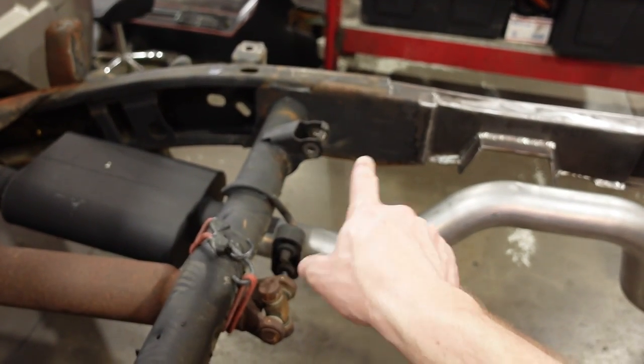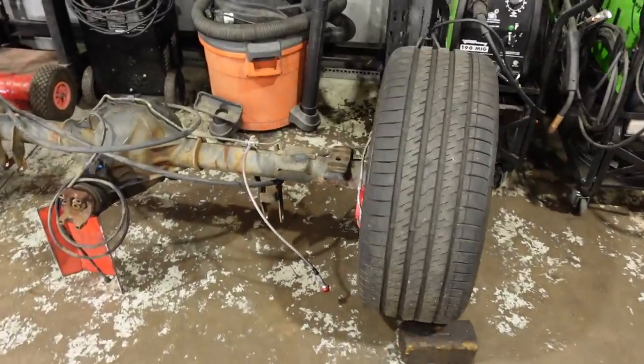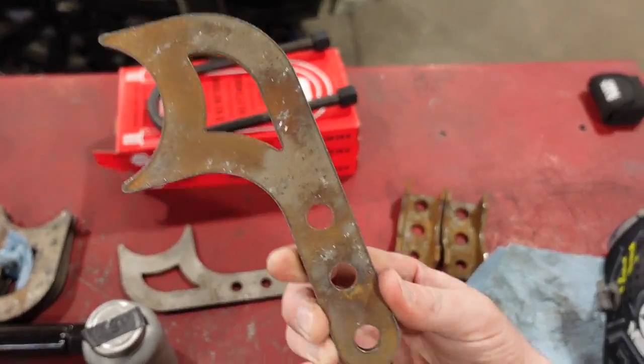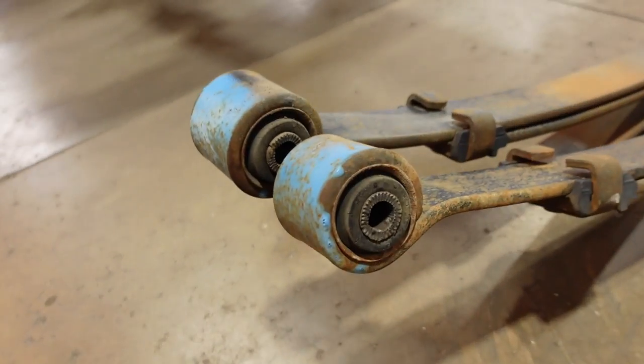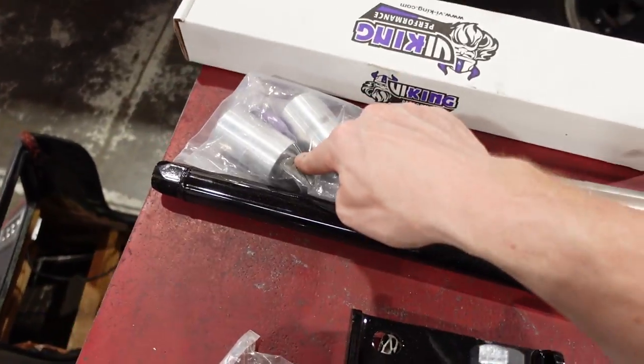We're doing a shock relocation so that mount is going to get chopped off — simply because there's no sense to leave that bracket there. This shock mount is getting chopped off, we're putting some Atomic Fabrication mounts back here, and then on the axle we have to do the same thing — chop off the factory lower shock mounts and weld on the stuff from Atomic Fabrication. Performance links will be down below in the description. Then once we have that done, we'll get a little bit of paint on the frame in the areas we're welding, and then we will install the cal tracks, which basically means we need to press out those two rubber bushings in the front of the leaf springs and replace them with aluminum sleeves. By the end of today's video, everything on that table will be installed on the truck, the wheels will be on it, it'll be sitting on the ground, and it'll be done.